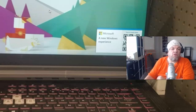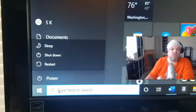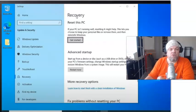If you're in Windows, go to the bottom left here where you can go to search, and type in 'reset this PC.' It'll usually be to the right of the Windows icon key. Type in 'reset this PC' right here, and then from this screen you're going to click on Open. From here it says Recovery, Reset this PC — if your PC isn't running well, resetting it might help. So click on Get Started.